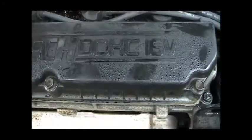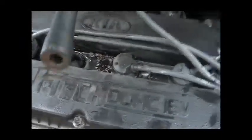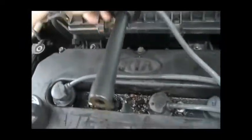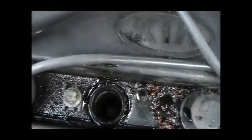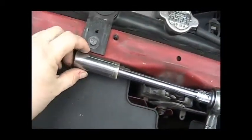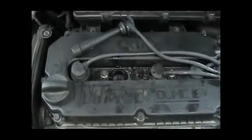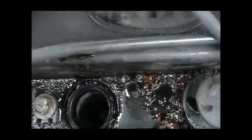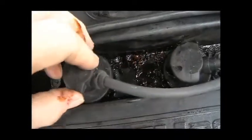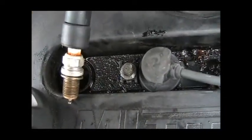These just pull off the top, like that — you just pull it out. That's the end of the wire there. Down inside the hole is the spark plug, way down in there. If you don't have a spark plug socket, I have a 5/8 inch socket which will fit, but it doesn't have the little rubber thing inside. My husband came up with a great tip: you unscrew it down in there with your socket, then you put your connector back down in there until it grabs the top of the spark plug, and when you pull it out, there it is — spark plug extracted.